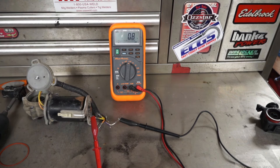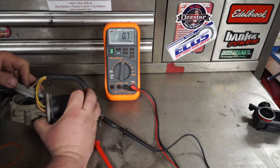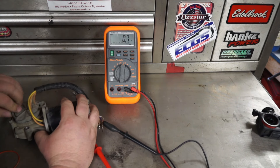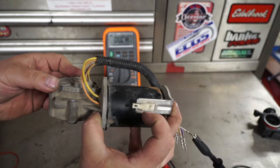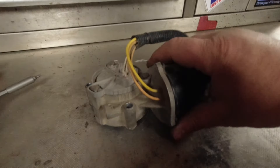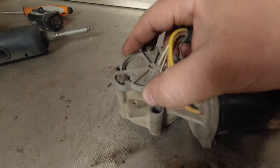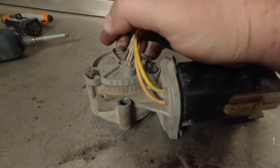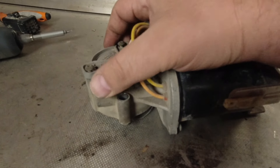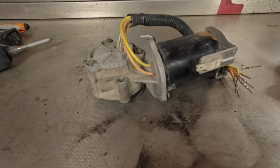It all kind of makes sense to me now. That confirms why you've got the marks there and then the marks on the case — to fine tune and adjust it. So I guess the real question comes down to: when you get the error and everybody replaces the transfer case motor, has this plastic piece with the limit switches failed, or does it perhaps just need an adjustment? Because with my buddy Dave, it wasn't shifting properly anymore — so it gives you questions to ponder.